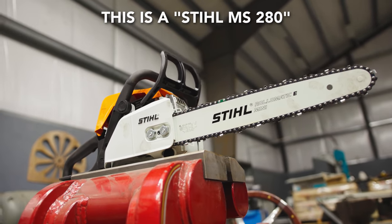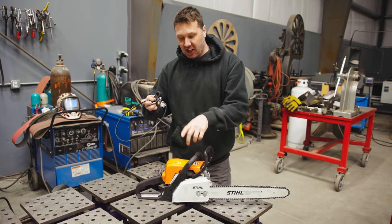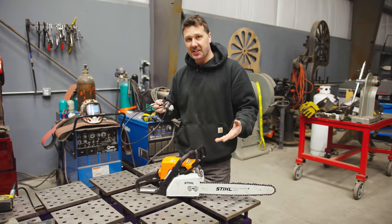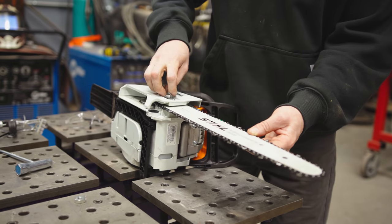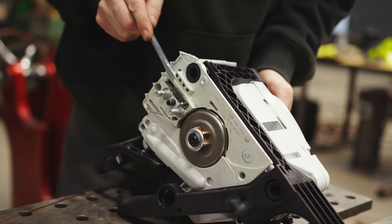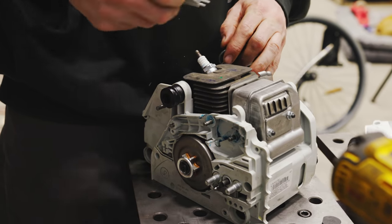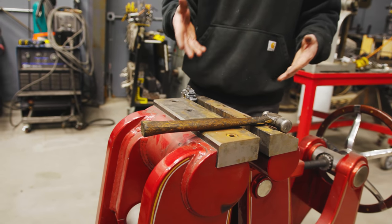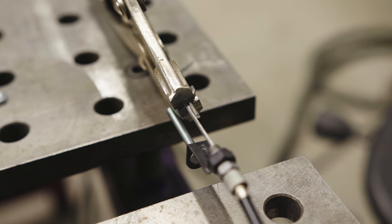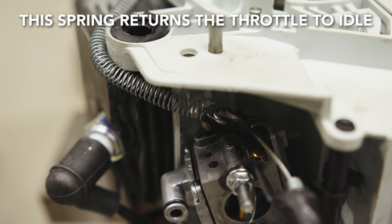I'd like to power the wheels with this, fasten it to the back of the wheel, and control it with a bike cable. I have to fit the bike cable to this machine — strip it down to get it as light as possible, then find some way to run a drive shaft off the side and rub it on the tire. These wheels are already getting pretty heavy, so it's essential I get this chainsaw motor stripped down to the bare essentials. Chainsaws are pretty cool because of their power-to-weight ratio — this one only has about two horsepower. With everything stripped down, it's now time to figure out how to attach the bike cable to the carburetor. The carburetor used to be a push style but the bike cable is a pull, so I had to drill a hole on the other side of the cam and solder a tiny piece of wire to make it operate like before. I also added a heavy duty return spring so the throttle doesn't stick.